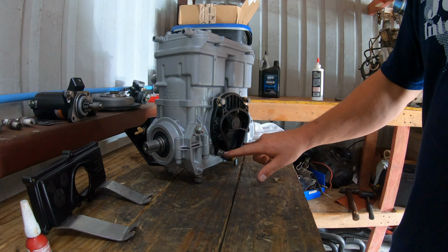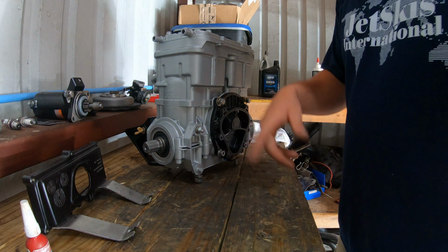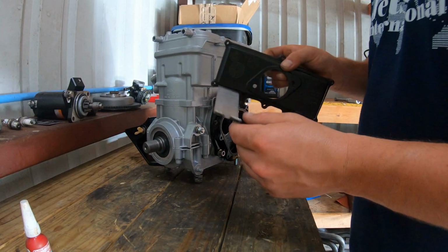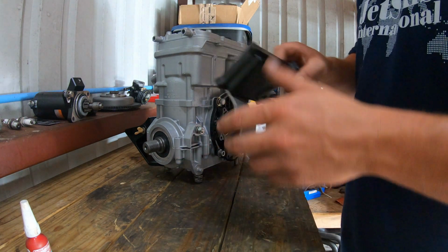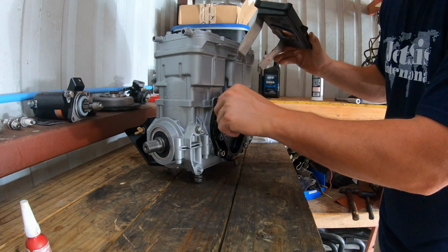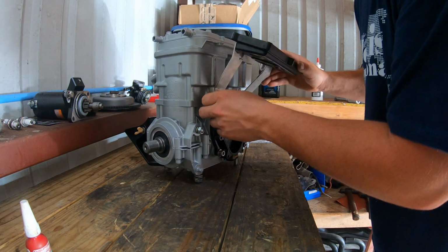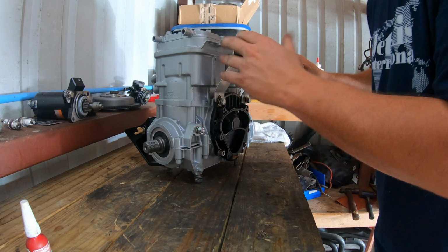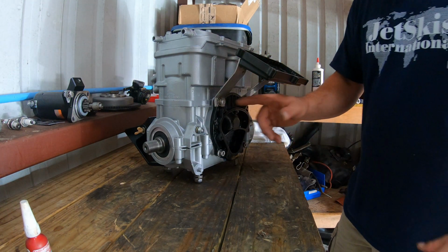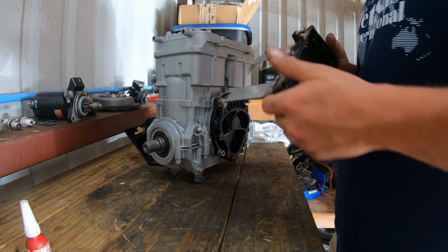Okay, I located my two bolts. I got two different ones up top, so you can actually put a wrench on it and not have to fight for an Allen head, because with the Allen head, you fight the clearance issue. With a wrench, you can just put it on there. So this is what I was talking about with notching it. I went ahead and notched it. It doesn't need to be pretty. I just need it to where it can slide on there. And it just slips. I can just slide it on and off now. Basically that's it. I just tighten it up, and the carburetor, I can take the plate off and get to the carburetor a lot easier than what it was.